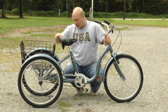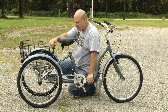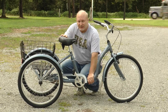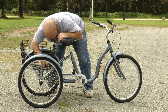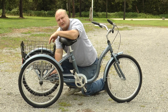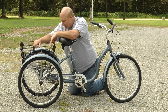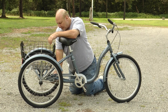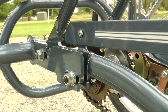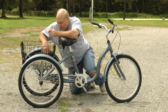Getting back to putting it together: once you have all three wheels on and the gooseneck and handlebars on, one concern I had seen was that you need a chain breaker. When I looked at the chain, there was a new-style master link — not the old-fashioned type. You put the chain together and snap it. When I looped the chain around the two sprockets I had a full extra link, but that's not a problem because there are slots on the back axle assembly on the frame. You just pull the back axle assembly backwards to tighten the chain to whatever tightness you want, then tighten the four bolts down to finish the back axle assembly.